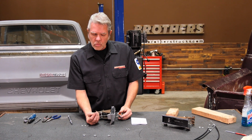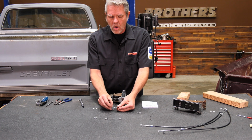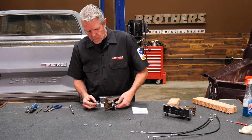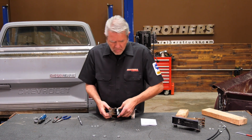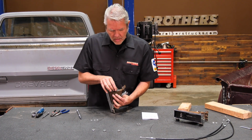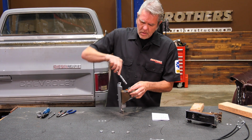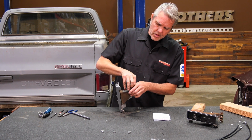Next, we'll put our switch in, but you're going to need this little plastic guy right here, and it's going to go on the knob that's on the switch right there. I'm going to switch that all the way up, and then this is going to install into the grooves that are on the middle fat lever right here. I made sure that it's in my groove good. I've got little screws that are going to be going on here. I'll just get that started so I can still move it around to get my other screw lined up.